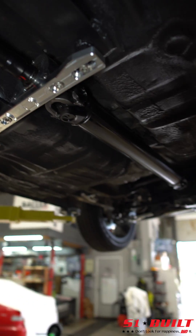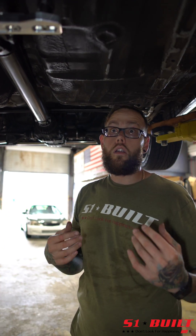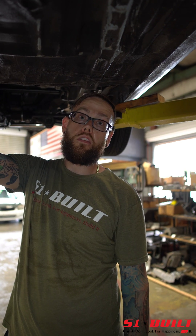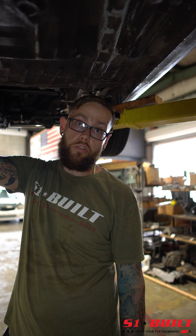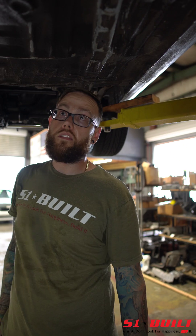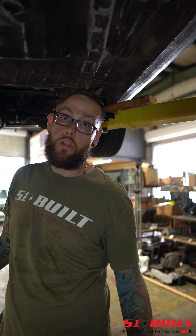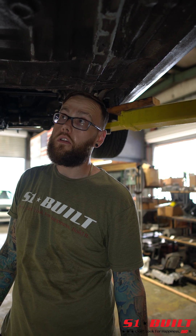Customers who have already purchased Freelander drive shafts are able to use this viscous inline — unbolt it from either side and bolt it into your current setup. It will give you more grip to the rear wheels, and you don't have to do anything as far as the length of your drive shaft. Overall it'll remain the exact same, so it's a direct bolt-in if you're already running a Freelander viscous coupler in your vehicle.